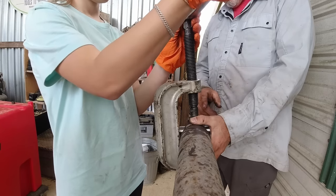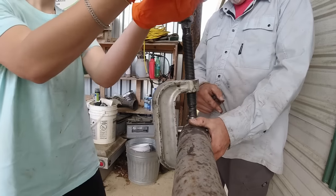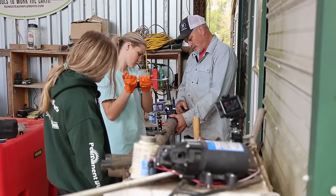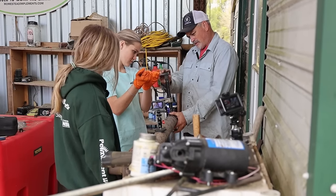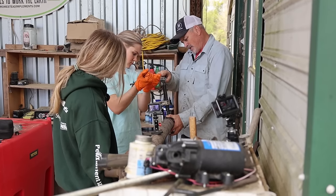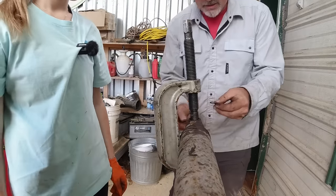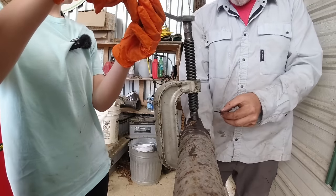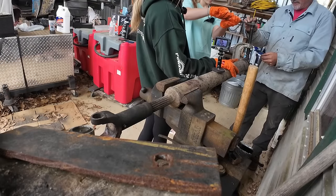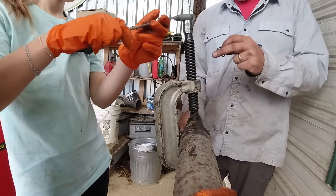And now you're going to want that thing to seat down in there so we can put that new snap ring in there, because we need to put another snap ring in. So you want to go just beneath the lip there so that we can put that ring in there, okay? Let's go just a little more. That's like triple the thickness of that. How about there? All right, now let's back her off. There you go.